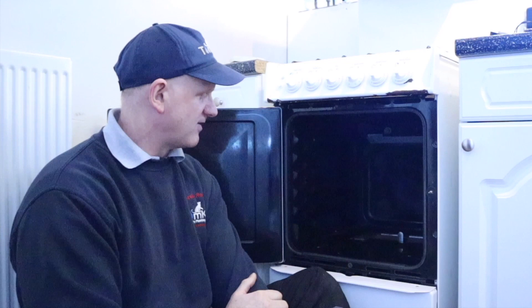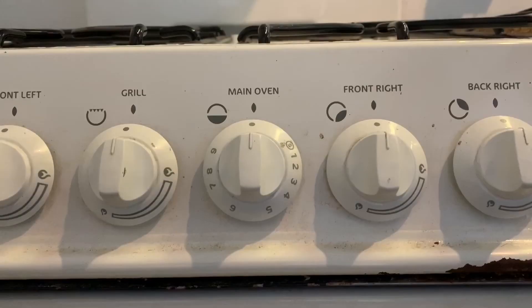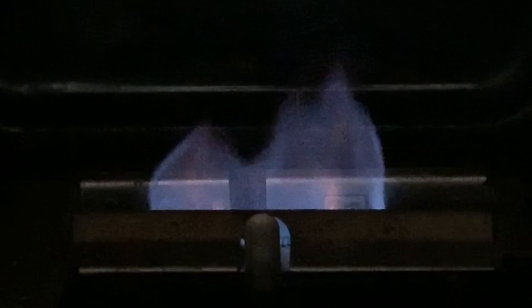This cooker has the liquid expansion or mercury vapour valve. The really old ones had mercury in them; the newer older ones have alcohol. To light the oven you press the oven knob in to override the safety device, then light it. This oven has to light in low rate — if it lights in high rate, that means the liquid expansion or mercury vapour valve is stuck in the open position, which would automatically make this oven ID because the safety device isn't working.